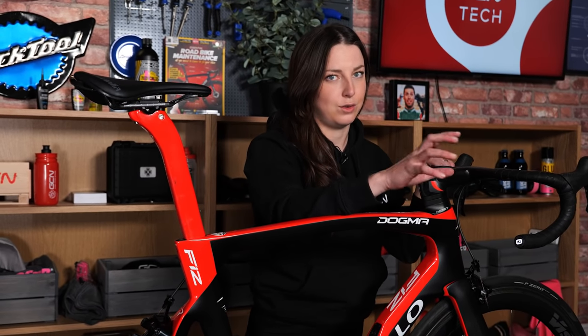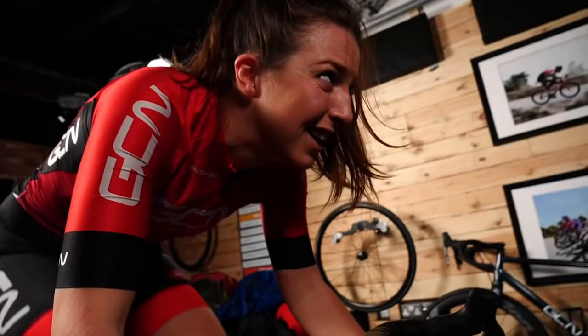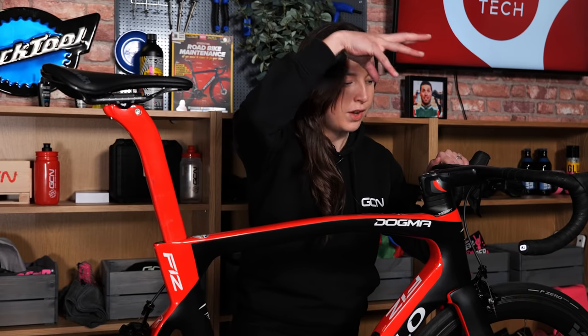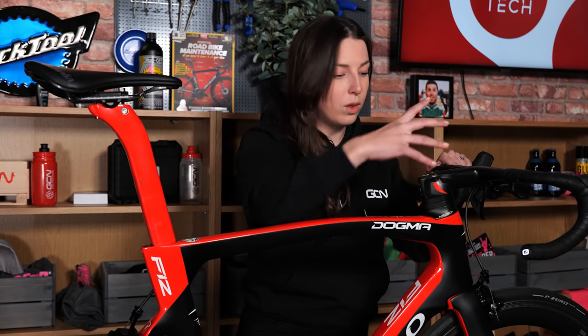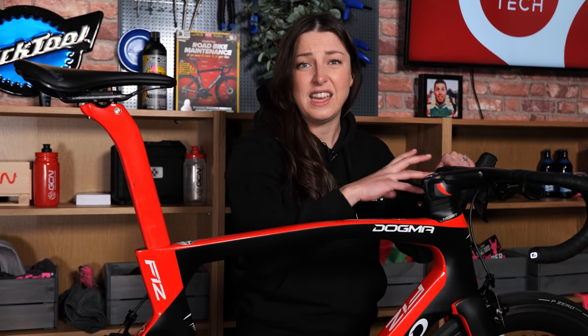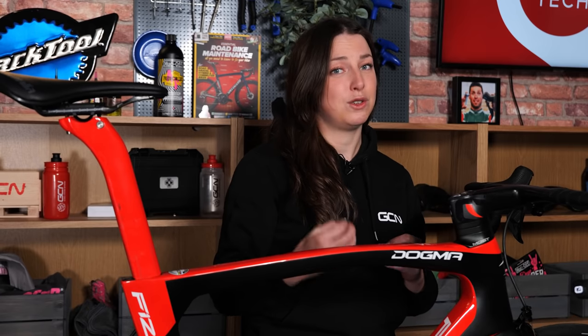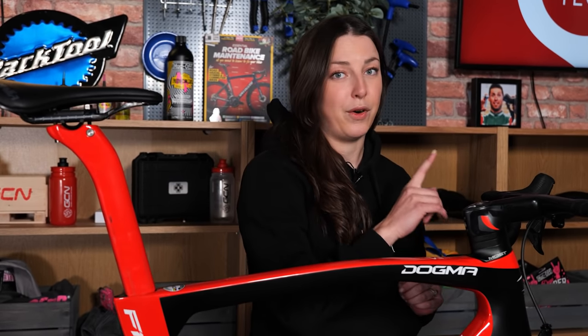This is probably the main culprit for destroying your bike on the indoor trainer. If you're doing indoor training correctly, you will sweat a lot. All that sweat is just going to drip right onto your headset and all the important parts of your bike and basically corrode it. All that sweat is also going to soak into your handlebars and get all grimy and stinky. If you are doing a lot of indoor training, you might want to think about changing your bar tape a little more often.